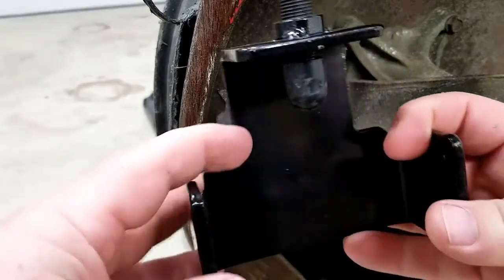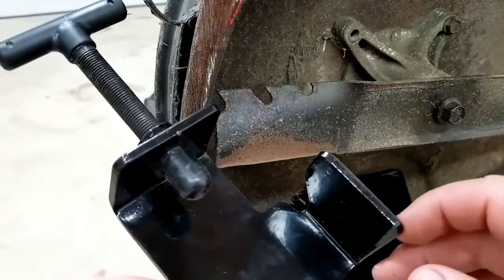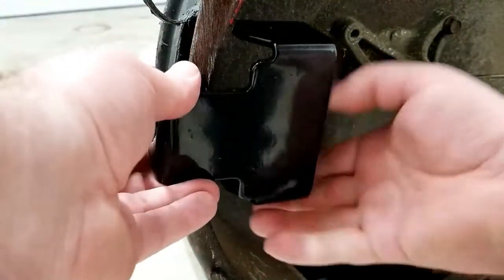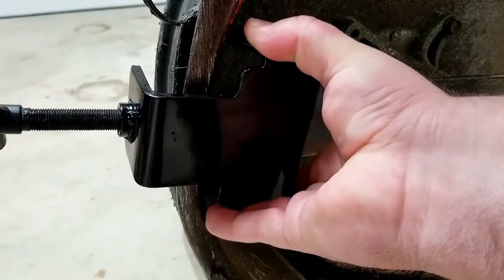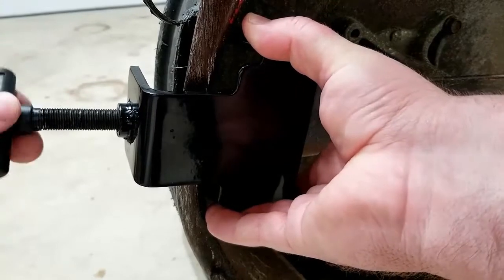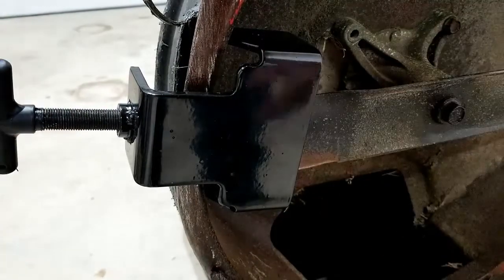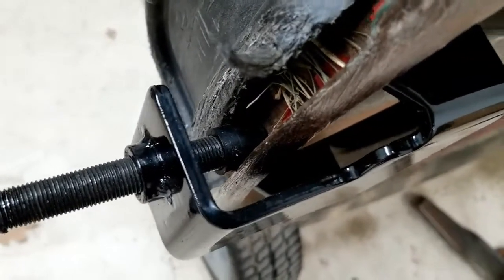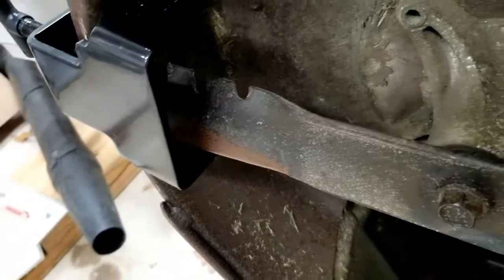With the tool, we want to make sure that the blade goes into the cavity and then we tighten that down onto the outside of the mower frame. Once you have everything situated, you just tighten the back piece down and it will lock the blade from turning. On the back side, make sure it's resting on the metal and not going through the plastic housing, and the blade is seated in that cavity.